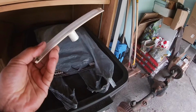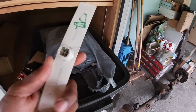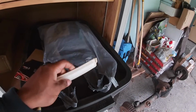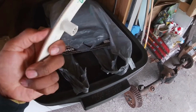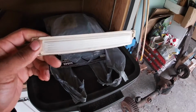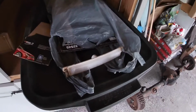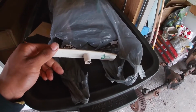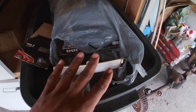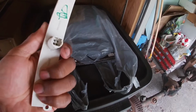Most of the time, these lights don't work, and you can replace these panels. As you can see, there are four plugs in there. You've got a power and a ground, and then another source that plugs into them. You can buy EL, electroluminescent panels, I think they're called, and wire them in. However, you can also buy strips that are already wired in and powered. You would just have to find a way to stick them in there on your own, and then find your source to power them.